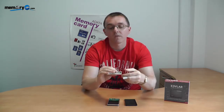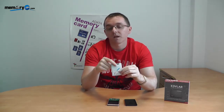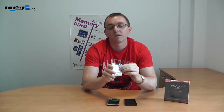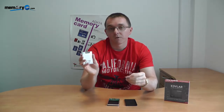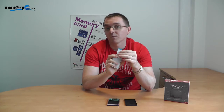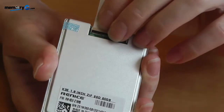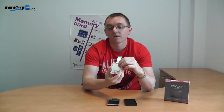I'm going to show you a quick demonstration of how you plug the cable into the product. On this product you have a black lever — this lever must be up at all times for you to plug the cable in. If you make a mistake, just take out the cable and try again, because it's very particular. I must take the thin end, keeping the plastic backing visible to myself at all times, with contacts facing straight down. I'll push the cable in on both sides to make sure there's full contact, then push down the lever to make a full tight seal.